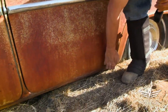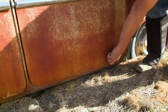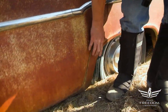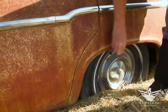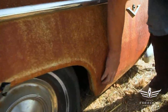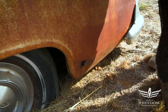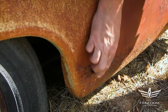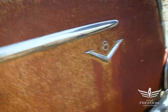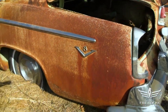The back door is nice down low; I don't see any signs of rust — a little tiny pinhole right there, but not a big deal. The rocker seems pretty good. The lips on the rear wheel opening are pretty good. Down low there is a little bit of corrosion happening, but the magnet sticks — that's a good sign. It hasn't been doctored; nobody's tried to fix that. That's honest first-generation rust, as it were. Gotta love the V8 logo on the back — in the 1950s, the V8 was the ultimate status symbol on the open road.